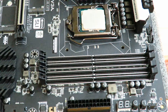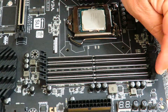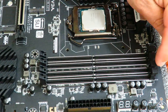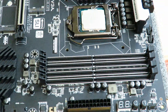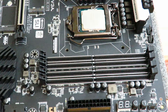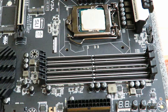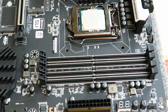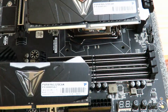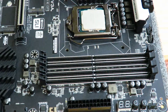The motherboard we're using in this video is the EVGA Z370 FTW motherboard. For this particular chipset, they want you to install the RAM in DIMM2 and DIMM4 — so this is one, two, three, and four. They give you a little legend right here on how the banks are named. Definitely check your motherboard manual before you install the RAM; it'll tell you exactly what DIMM slots to use, since it may be different on yours.